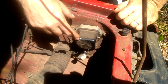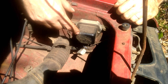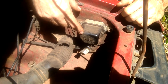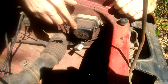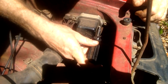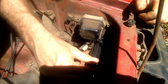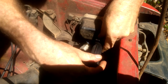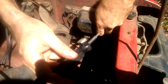The problem I've been having over four years of owning this truck is it tends to cook batteries. This is the third battery since I've owned it because it basically boils the acid in the batteries. This particular one has been charging at about 15.5 volts, which I think is too much. But you can actually adjust it if you know what to do — and that's what I'm going to show you in this video.